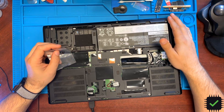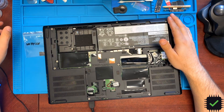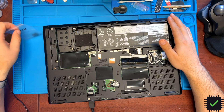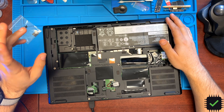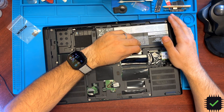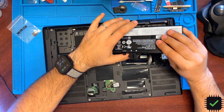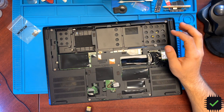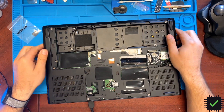But a quick workaround — if all you need to do is just get the laptop working without replacing any MOSFETs, what you need to do is disconnect the battery completely and remove it from the system. You're going to lose the battery obviously, but you're going to have a working laptop if that's all you basically need.